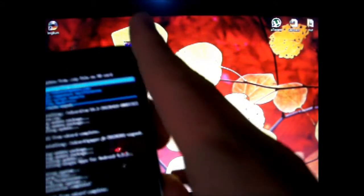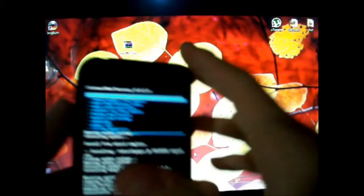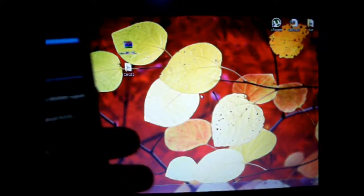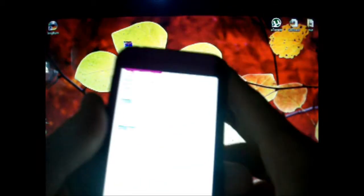And if you ever want to go back to stock, I have a stock image boot I can put in the description for download. So if you reboot system now, if you're on S-on, it'll just get stuck at that HTC loading thing because there is no image file for it to load. So I'm just going to go to power off, and then I'm going to hold volume down and power until it boots into the bootloader menu again.